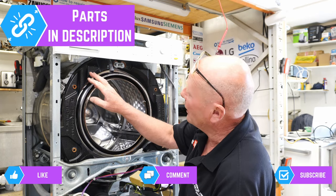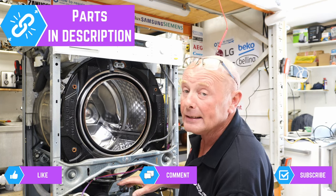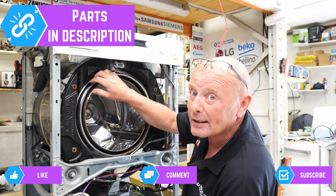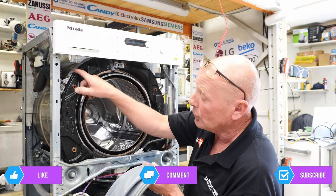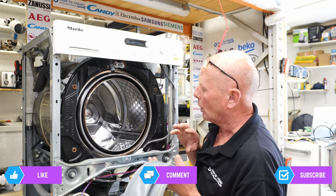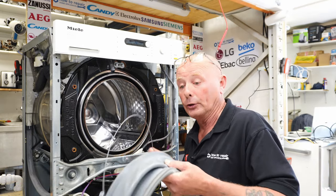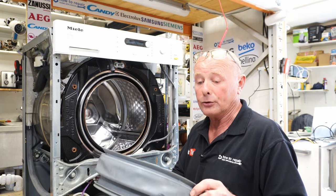Just a tip — it's sometimes useful to actually take the concrete blocks off, but you may need to support the drum when doing this. It gives you more ease of access getting the seal over the lip and over the actual top. You only need to undo the spring and the two bolts on either side, and the concrete blocks will come away. There's a joining bar at the top for the concrete. The inner clip is also in good condition, and the door seal only needs cleaning up — it hasn't been damaged by the drum in any way.